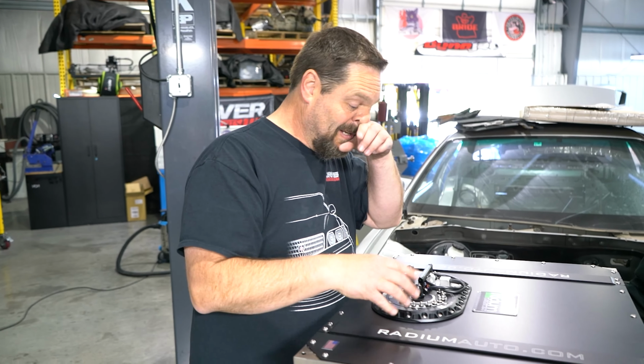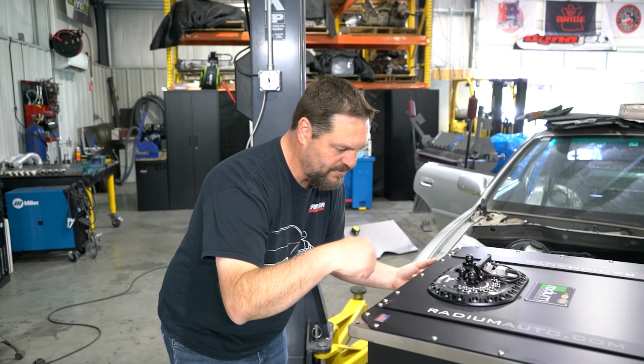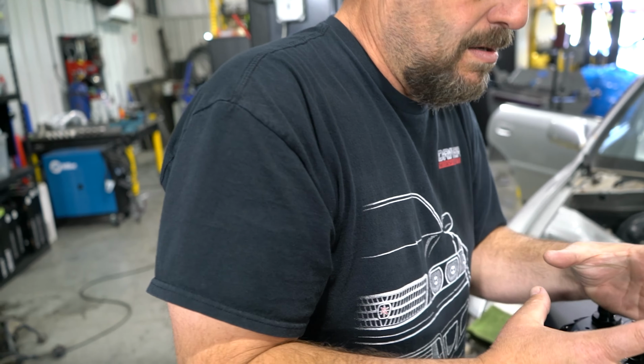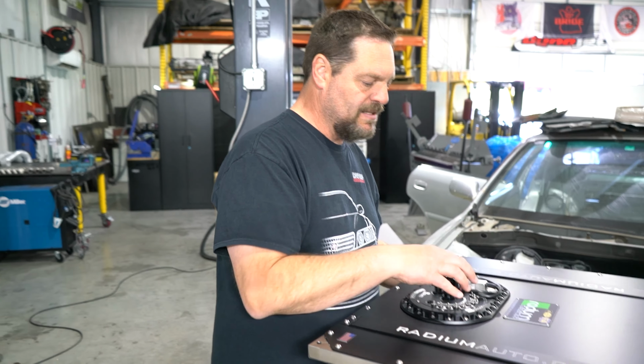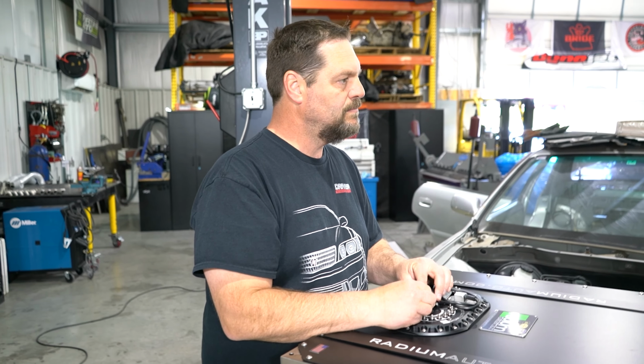So it's like a tube down inside there, and the one pump fills that constantly. So it can't slosh away. So it only pulls from this area, but this is the residual fuel hanging around the edge. And then that one pump just pumps it in there, and then it's got 2 pumps pumping it to my fuel rail.